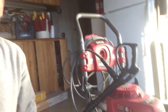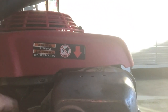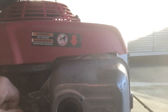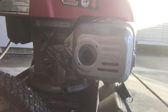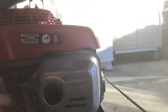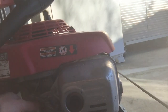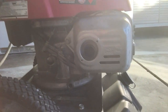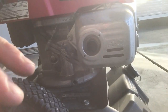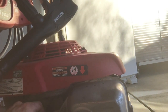This I change about every year, just like my generators, because they get a little bit more use and they get hotter. You're going to basically just break this open for oil, and you'll check it. That is a little bit dirty, so it probably wouldn't hurt for me to change that, or I'll wait till spring and go through the winter. You can see there's a dipstick on that, and I'm about a third of the way up to this line. You don't want to be too high, or you're going to crack a seal.